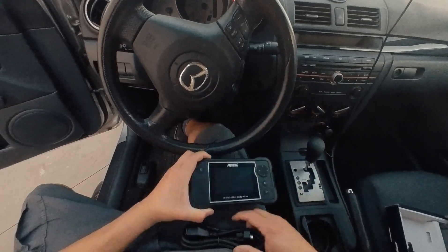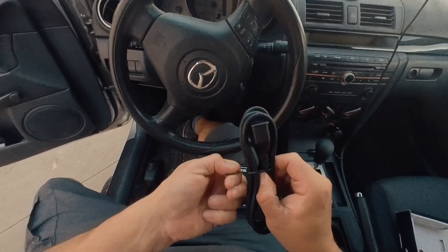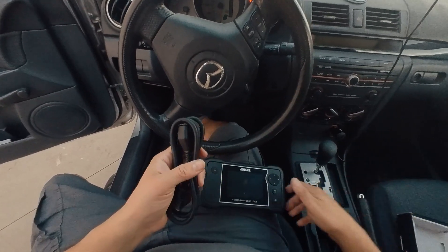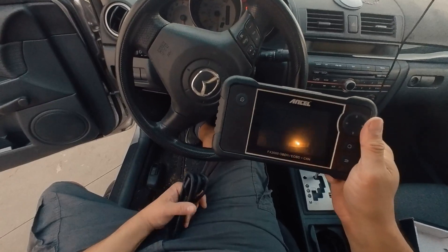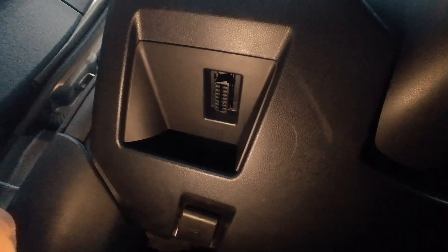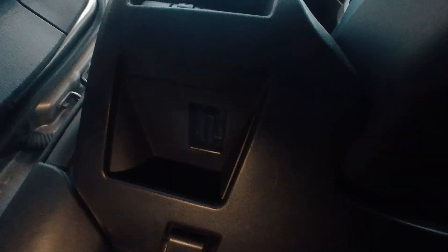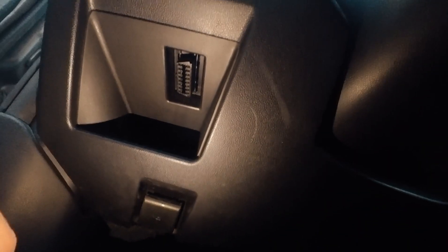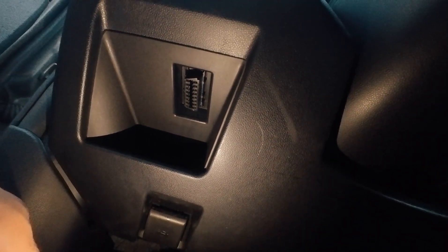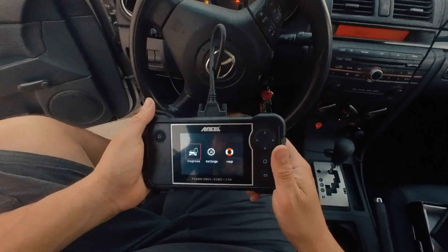We're going to go ahead and activate the system. In order to make all the functions work, you are required to turn on your car. Out of the box with the engine off, you can only get the VIN number, battery information, and so forth. If you want more information, you'll need the car running. It's connected right here underneath the car — it's a bit dark in this area but I'll light it up. You just have to find the port; it could be underneath or higher up depending on the car. It came up automatically once connected, but to run diagnostics properly you have to turn on the car.